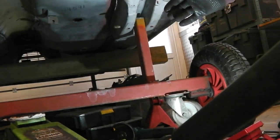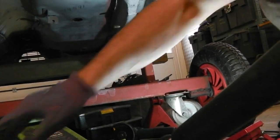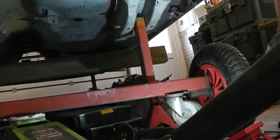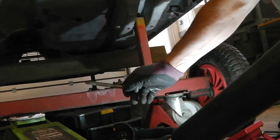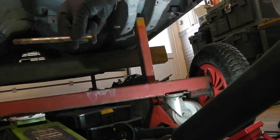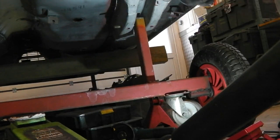And now, what I do to get a nice bit of tension on it and to assist it with the car, we put the other bolt on the other leg so that the dolly jig pushes the car equally. Now, the other chassis leg's a bit knackered, so it's probably going to collapse a little bit on it, but I wanted to jack the car parallel. In other words, both chassis legs jacking up at the same time. It's just a little bit better that way.